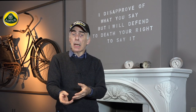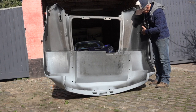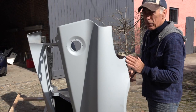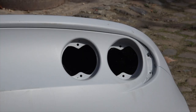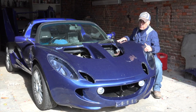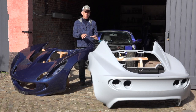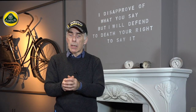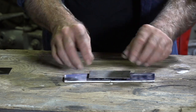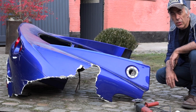By the end of last year I finally got the two new clamshells. The rear one is a secondhand unit in very good condition and already prepared. The front one is secondhand as well but in pretty bad shape, so I still have to fix that one. You will see a video coming in 2019 on how I'm fixing the clamshells — cutting pieces from the old clamshell and putting them into the new one, and using an aluminium or steel plate in the back instead of polyester to glue things together.